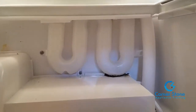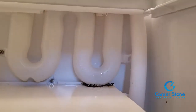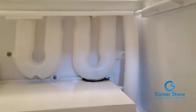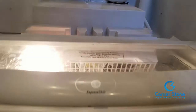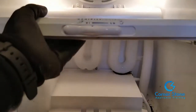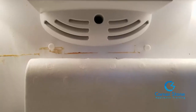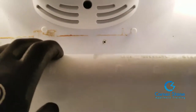If you're not sure the problem is the water tank assembly, push the water lever at the dispenser with the selection on water. It's leaking about midway on the last rung of this water tank assembly. Since we've already removed the crisper drawers, we're going to remove the top shelf for exposure to the water tank assembly — it has a small plastic top shelf, just push down and remove it. There's also styrofoam on top.